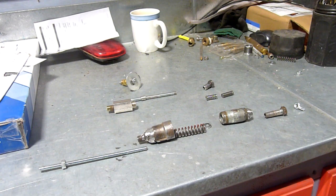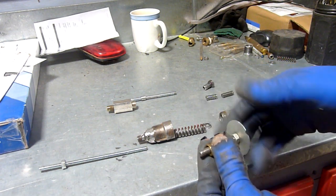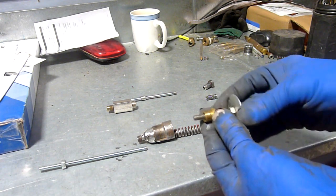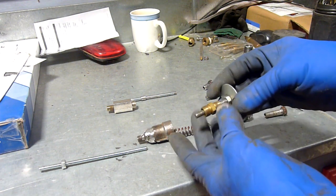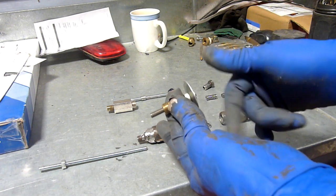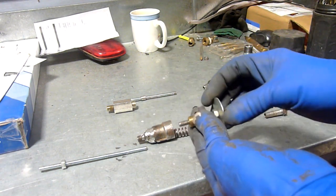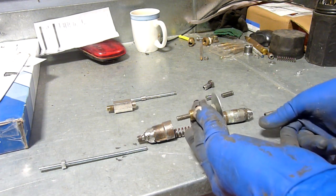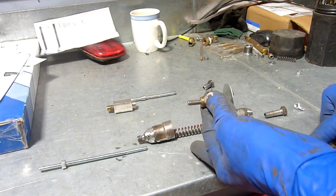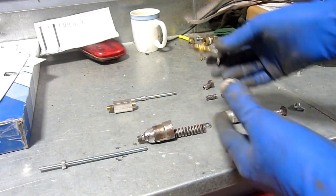Here's the history of the adjuster fabrication. This is the one I got first from a fellow online, and it does not work — you cannot use it in a regular hydromatic. He was using one from an M24 tank, which had a secondary indicator. Because there's no way, when you turn this in the six turns like they say in the manual, you bottom this to the rod inside the servo and then turn it six turns to compress it to a preset limit — you have no way of knowing where you are putting the adjusting screw. There's no feedback at all.